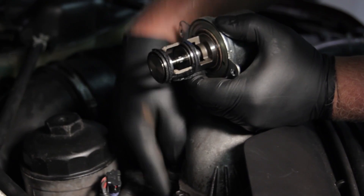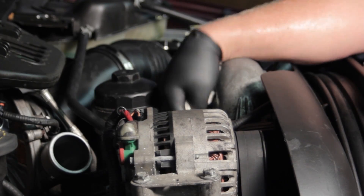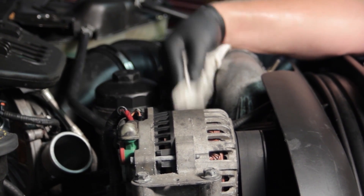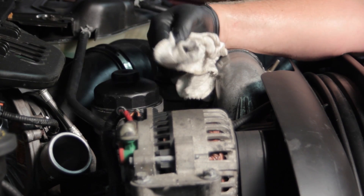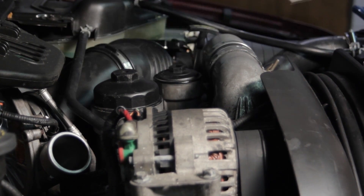We're going to make sure that all the carbon is cleaned out inside of here as well. We've cleaned out the carbon in there — I've used the shop vac to clean out any chunks, making sure they don't get stuck in our new valve or get passed along to the EGR cooler. And now we've finished cleaning up the surface.